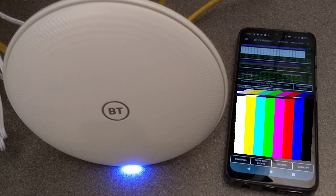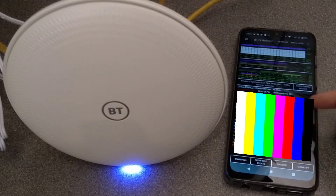If you need to, you can either go and factory reset the satellites individually, or change a setting on the main one and it will probably sort out the settings on the satellites. I can now see on the phone with the Wi-Fi scanner that it's reset the main one to 'BT Whole Home' and a number, and the other ones have stopped transmitting at the moment.